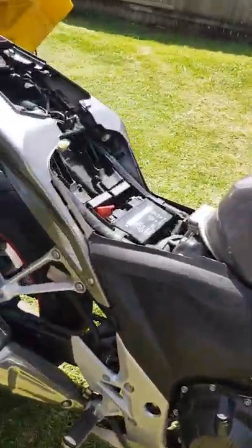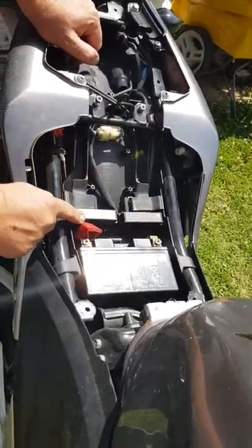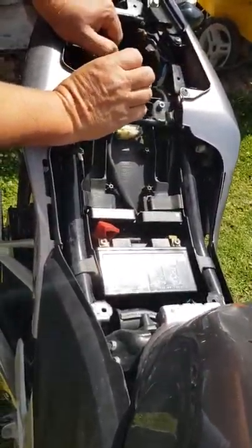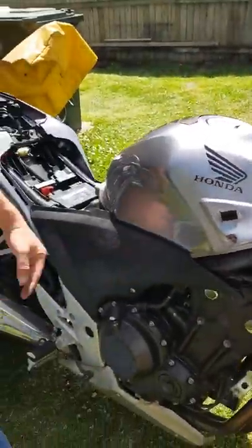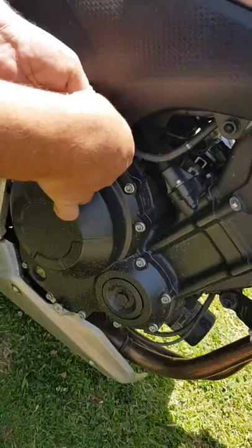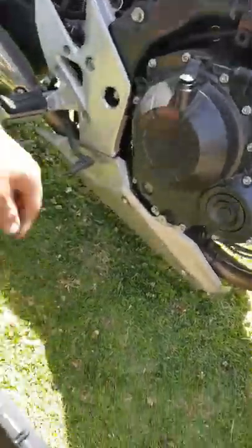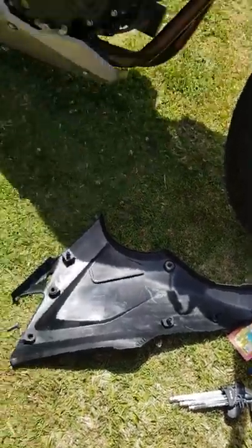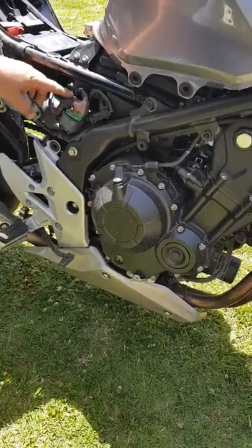Take your seat off. So you've got your battery here. He said he's checked all those fuses, but it's got nothing to do with them really if you've got no power. So what we do is we'll take this plastic cover off here. We need an allen key — take that one off and this will just pop off.